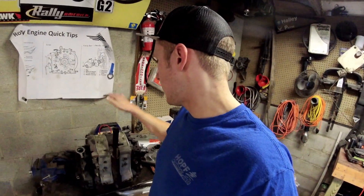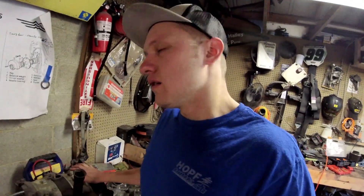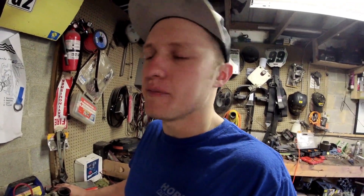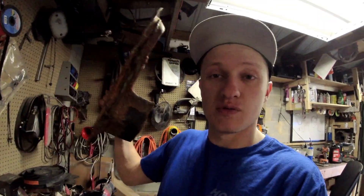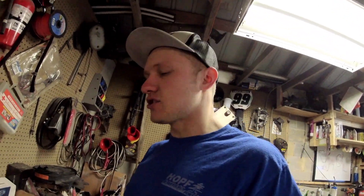We're going to go through what I have laying out here for this to work. My brain says a 50s Ford is probably going to have a pretty big front K-member. On a rotary, the oil pans vary in depth and shape and all that stuff. This one's custom, as you can see. You'll have to make sure that you pick a proper oil pan, and what engine you have is going to determine that as well.